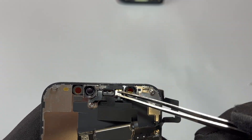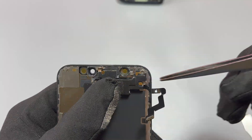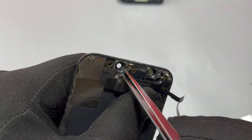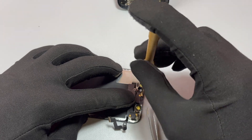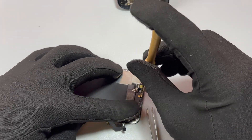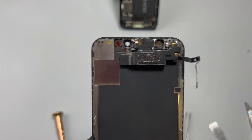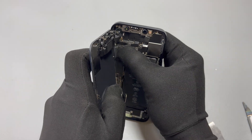The reinstallation is practically the same: insert the smaller piece of flex cable and sensors first, then push the earpiece to its final position. After that, insert all four screws back to their original positions and do not over-tighten any of them. Make sure the flex cable on the left of the camera hole is not pinched. After installation, give it a final inspection.